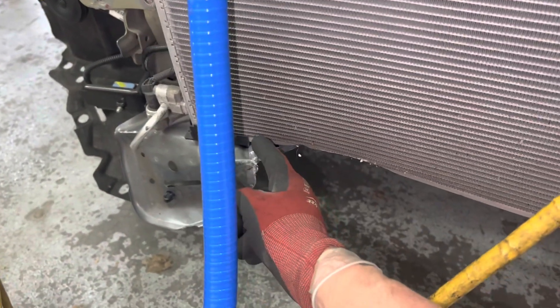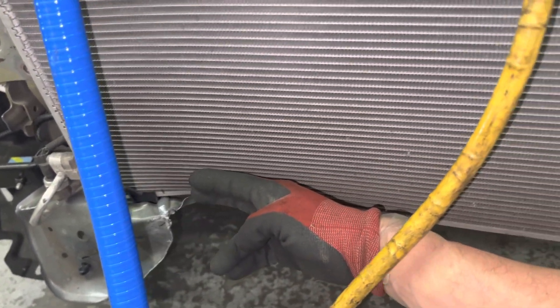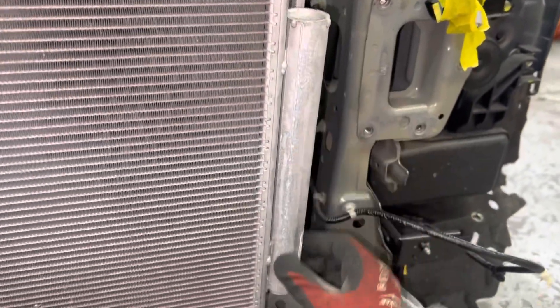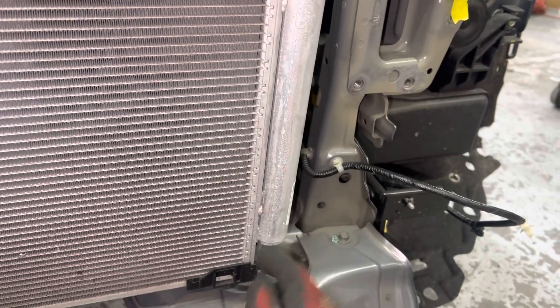In the last four, five, or six of these little tubes down here — these are the sub-cool passages that are filled with liquid refrigerant because they come out of the receiver dryer. The receiver dryer separates the vapor from the liquid, and it allows the liquid, which has the oil in it, to go down to the bottom. So down here is liquid, there's a little passage, and all these are filled with liquid.